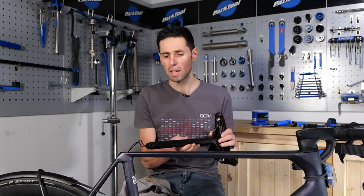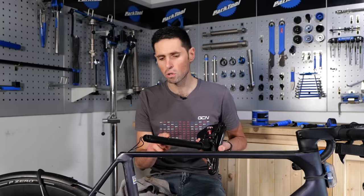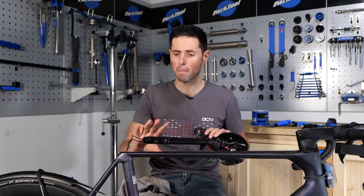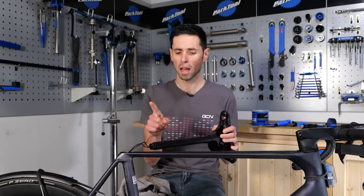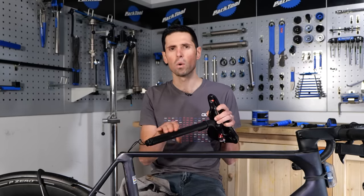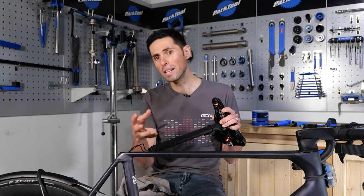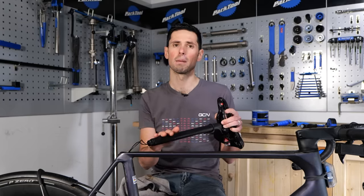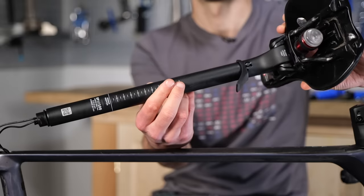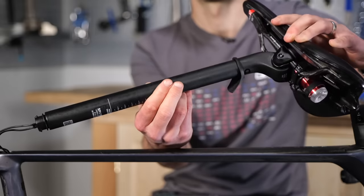What's also very important at this stage is, now that we've got the seat post clean, we can start to visually assess it to make sure there are no cracks or damage that could be impacting clamping performance. It's important to note that on some seat posts you'll find a section that feels quite rough and abrasive to touch — don't worry about this, it's designed that way to help stop the seat post slipping. Make sure everything looks good to go before moving to the next step.